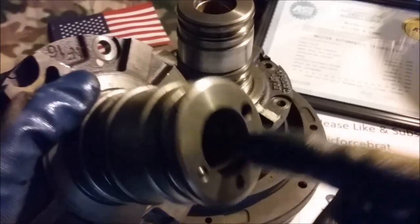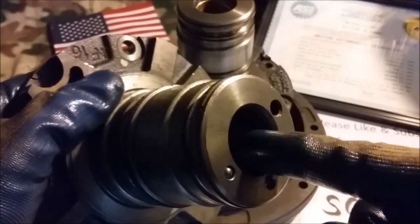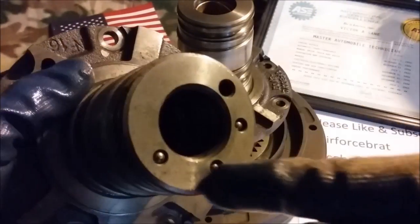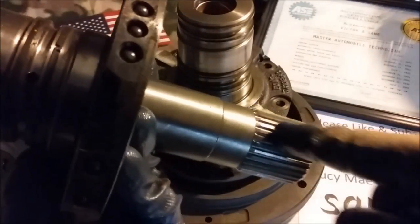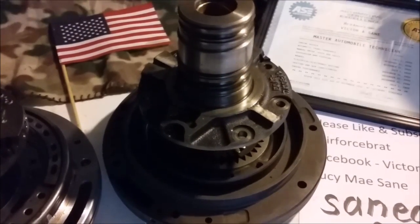In 1995 you start seeing a lot of these stators where the bushing is not all the way to the top — it's way down here. And you have three holes with balls in them and an additional hole right here. It looks a little different here too, but that's inconsequential.